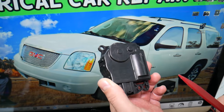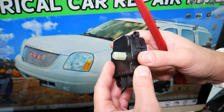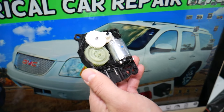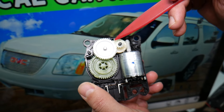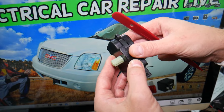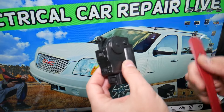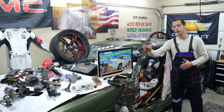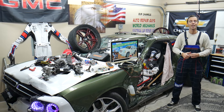This device is known as a blend door actuator. If you have a single climate control, you have one of those on the front. If you have dual climate control, you have two — one on the driver side, one on the passenger side. That thing attaches to a flap that opens and closes, regulating the temperature whether it blows hot or cold. Inside, you have plastic gears and a motor. Usually those gears will crack, chip, the teeth will wear out, and it will start skipping, or the motor will burn. As a result, the heater may be stuck in the cold position — that's why it blows cold on the passenger side, because of a bad blend door actuator. We've seen some fail as early as 8,000 miles. If you want to see how to test a blend door actuator and what the symptoms are, we have videos on our channel. Hopefully this video was helpful — thank you for watching and see you guys next time.